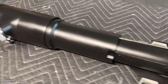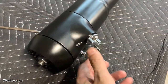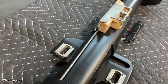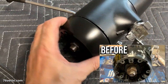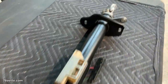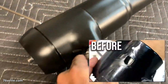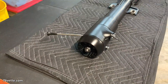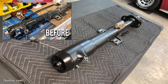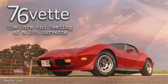Here are some close-ups of the whole assembly, including the harmonica connector. As you can see, it's locked. When you turn the key to run, it unlocks the steering wheel. This acts as a safety feature — if you connect that lever at the bottom to the reverse lockout, you basically cannot lock the steering wheel while driving the vehicle. That's it, thanks for watching!